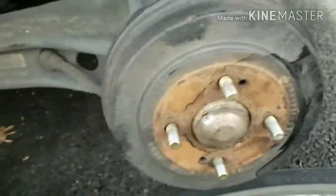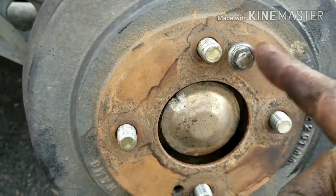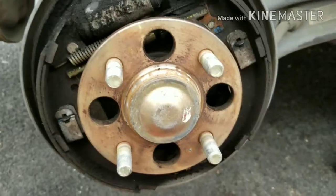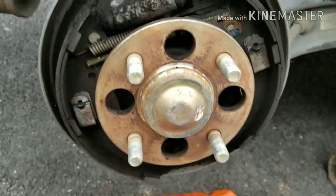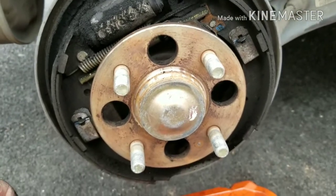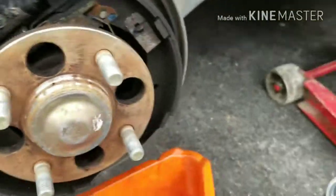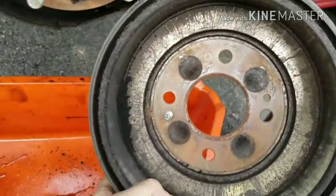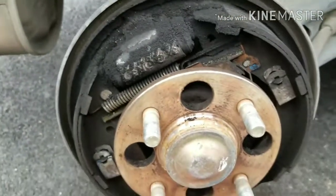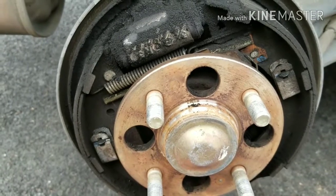First you want to take your tire off, and then with your drum here, sometimes you have a forcing screw or a threaded hole where you can force the drum off — it just takes it off like so. And once you look inside here, you have your brake that has a whole bunch of dust on it, and that dust hangs up and makes a ball. The ball gets stuck in a spot on your drum, like down here on the corner, and it binds up, makes a grindy noise, or if it's really bad, it's not going to let your tire move.